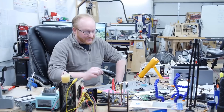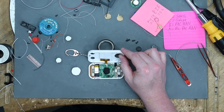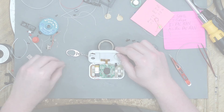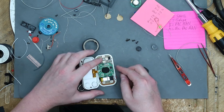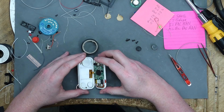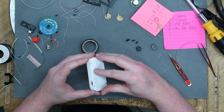I reprinted the case — 0.080 inches thicker. I reprinted thicker versions of the buttons, but then I also tried just putting funky foam on the existing buttons, and I think that'll work just fine. Let's put those in place. I also detached the screen from the main LCD — the LCD can still lift up, but since it's got thinner wires, it's better not to move it more than necessary because eventually they'll break. This flexible ribbon cable is meant to be flexible.